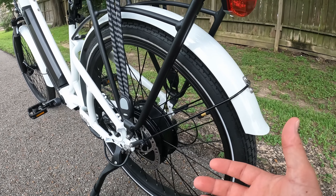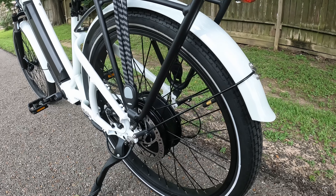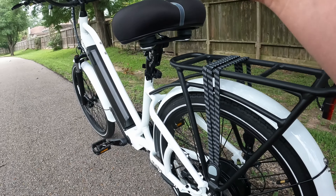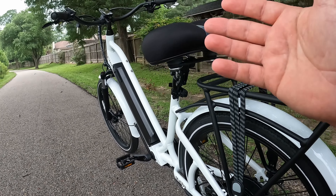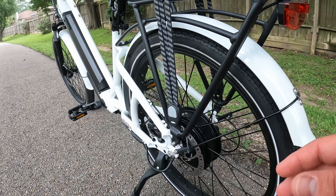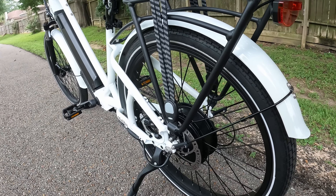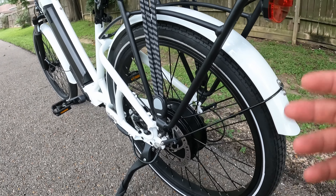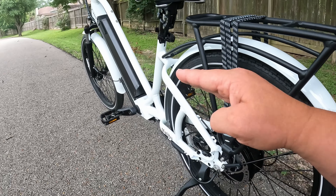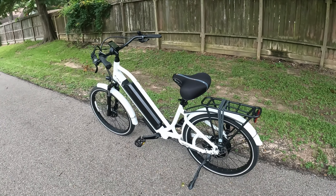In the display they have the ability to change what ride mode you're in: Power, Normal, and Eco. In Power mode you get all that torque and get-up-and-go, but for some people — especially on this bike — you might not be looking for that. All you have to do is go into Eco mode and it changes the torque curve. Instead of a sharp rise, it's a nice gradual climb in power, making it a lot more controllable and docile. Some people would really like that.